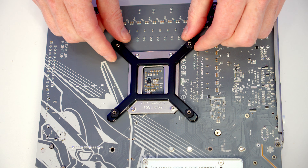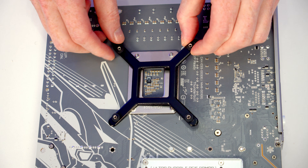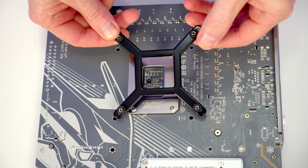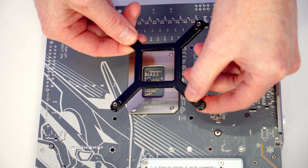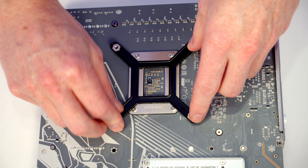If you're going to be installing on an Intel motherboard, the first thing you're going to do is install the backplate. For LGA1200 you're going to want to make sure these standoffs are pushed towards the middle. For 1700 and 1851 — I've got an 1851 socket here — you're going to want to pull them all to the outer setting and then they should line up with the holes in the back of the motherboard.